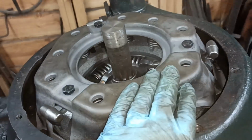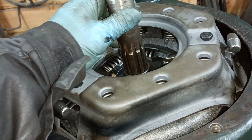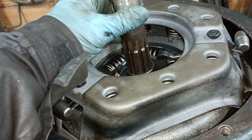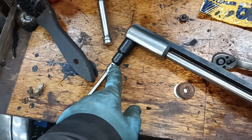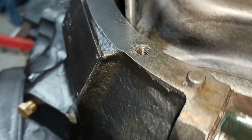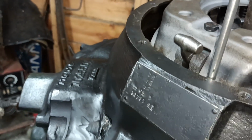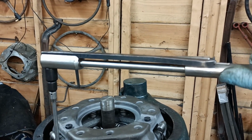Hello. I loosened off the pressure plate and aligned the thing, and that now goes in okay. So that's good. The pressure plate bolts, the torque is 17 to 20 foot-pounds. So here's my torque wrench, with a reducer, and I've just done them, but you really need that 1/4 inch drive on these to get down there onto the bolt, and then you can, you know, I wouldn't really normally do it one-handed, but you'll see the thing shoot out there.